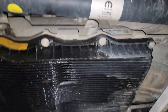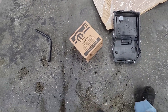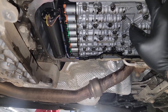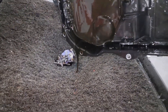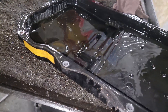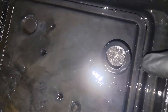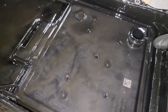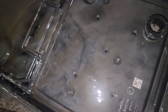I've got my drain bucket ready — doing an 8/9-speed ZF automatic transmission service due to leaking, and they were due for a service anyway. Pan is off now. This is why it's important to service these things and forget all that fill-for-life mumbo jumbo. Here's the old pan — remember, this fluid is supposed to start off clear greenish. Look how dark it is at 80,000 miles.